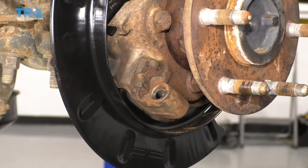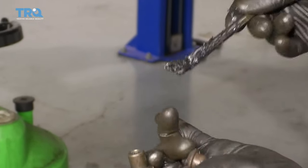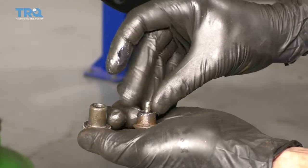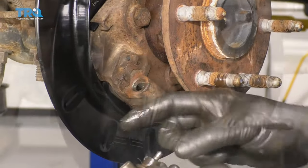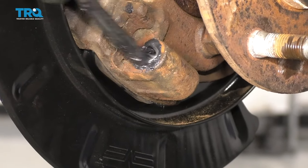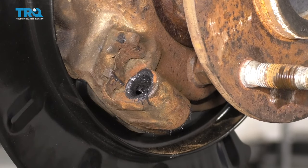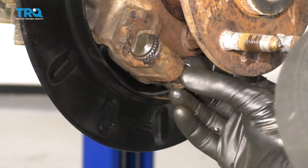What we're going to do is grab some caliper grease and put it right inside the hole on the other piece. This is going to be the other end — just try to fill it right in there. The more the merrier. Now I'm going to grab my nice clean pin — I inspected it, it's in good condition — and just put it right in there. Now we need to put a nice coating of that grease all along the areas where it's going to rub up against the unit. Now that those are nice and coated, we're going to go directly to where the adjuster is going to be. You can put in as much grease as you want. If you put in too much, it's not really a big deal, but it will kind of come out, so you'd just clean it up so you don't get any mess on your emergency brake shoe. Now take our pieces — should slide right in there. Make sure it spins like it should. Do the same to the other side.